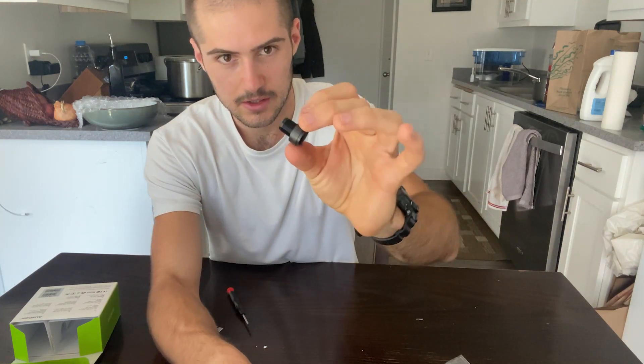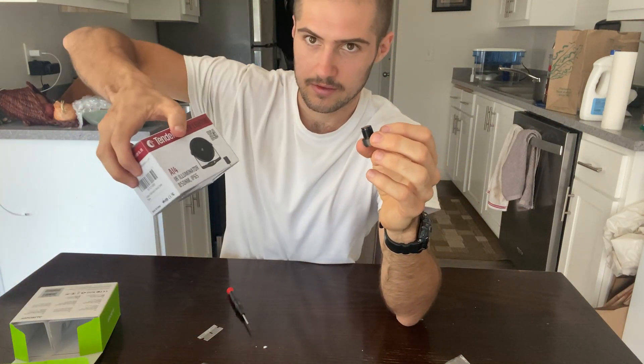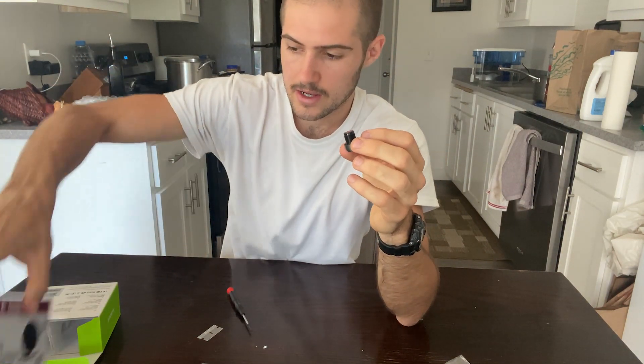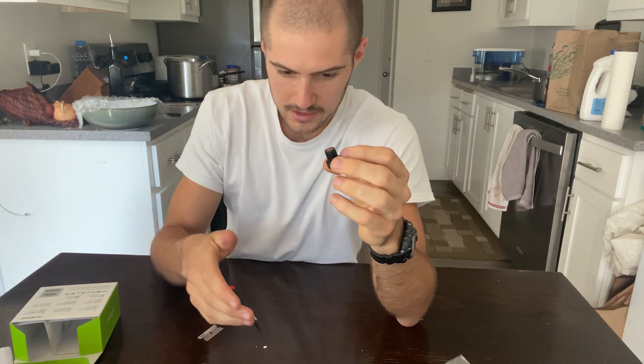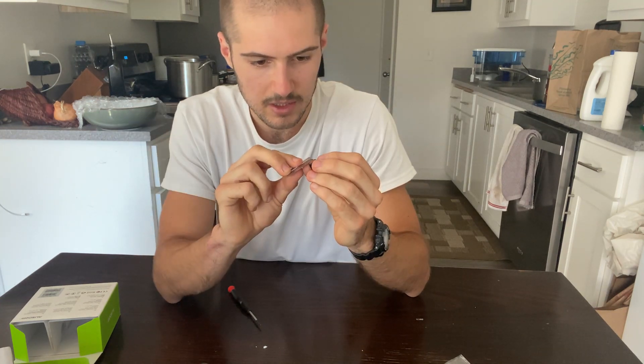As you can see in the lens, there's a little red piece of glass — that is the IR filter. So once we remove this, then with the aid of an infrared light, an IR light, this camera will be able to see things that are not visible to the naked human eye. So what we're going to do is pry this little piece of glass off.